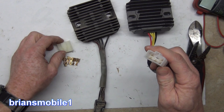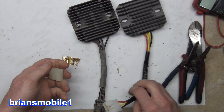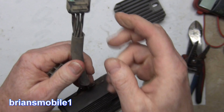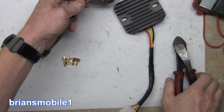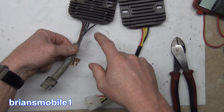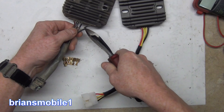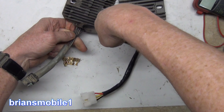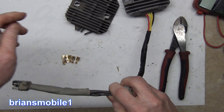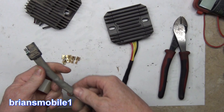This comes with six positions on it. We're not going to use the middle one right here — just going to use the rest, and it's pretty reasonable the way it's laid out with your field wires at the bottom. I just need to make these all match. There's a little corrosion on this one so I've got to run a continuity test. Most people cut the factory plug off the machine and splice these on. What I'm going to do is make an adapter out of this plug so that I can use either one — this creates options.